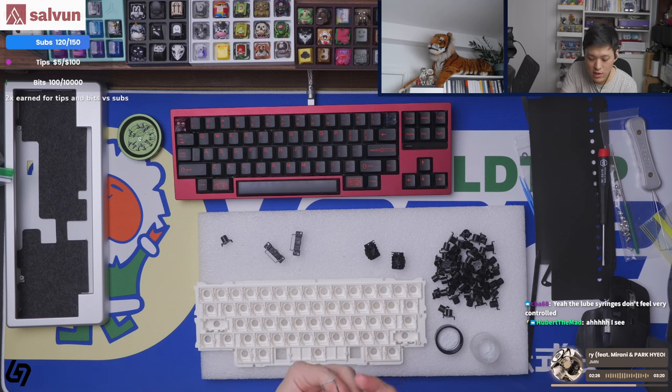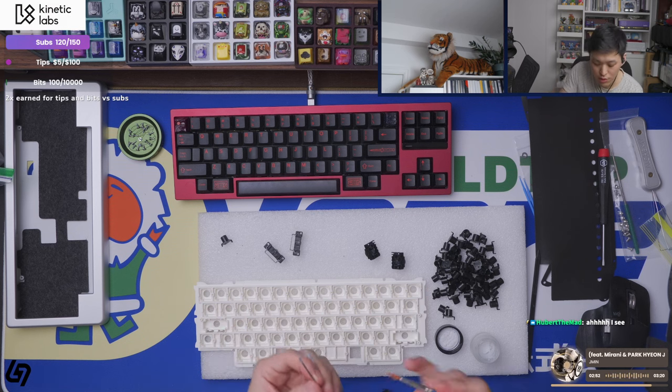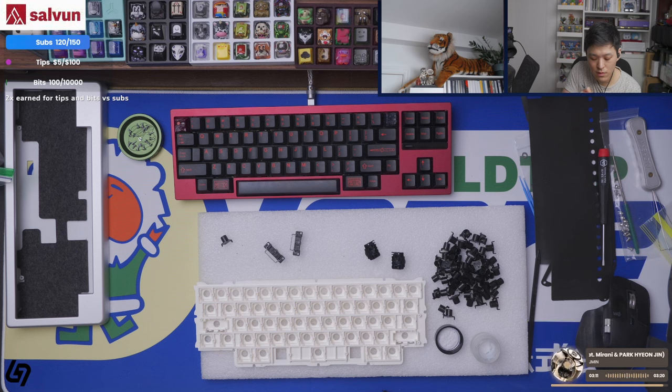Real Force cases, on the other hand, are more likely to allow you to just plop in, quote unquote, assemblies, because there you're effectively using the internal plate of the Real Force keyboard itself, onto the case. It's just the housing that you're getting aftermarket. But in the case of the Heavy Grail, that's not the case. Anything that involves moving the sliders over from one plate to the other, or separating the domes from the rest and things like that, will not be a simple transplant process. And the Heavy Grail is probably the most exemplary case of that.